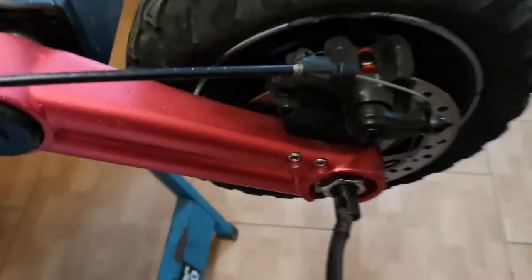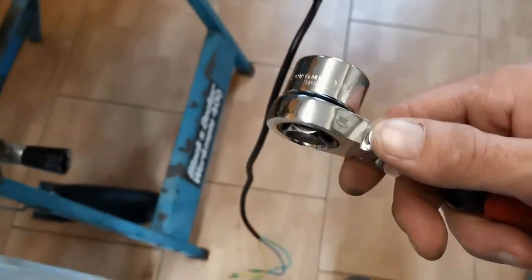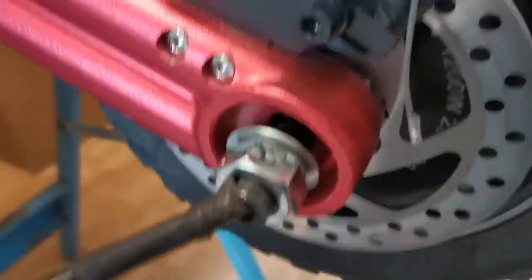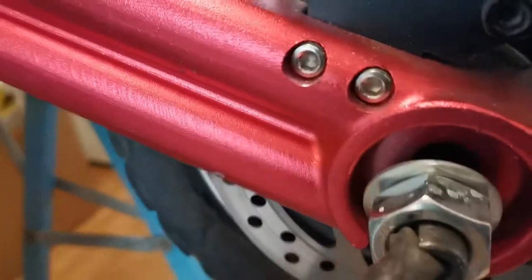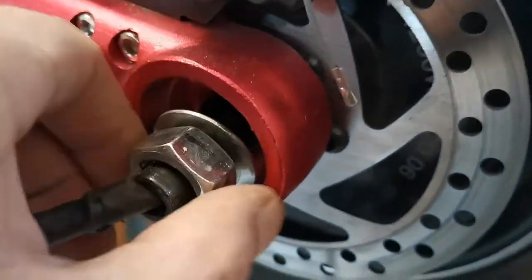Once you've freed the motor cable you can go ahead and remove the rubber cap. That allows you to access the nut, and you can feed that through your socket or through-hole wrench if you have one. It is a 24mm socket that you require. Check the direction just to make sure you are pulling it the same way, then feed both on at the same time. Once you've loosened the nut, it's a good idea to hold on to the top with one hand if you're working with the scooter elevated, because as soon as the nut and washer come out of this hole it will drop down.